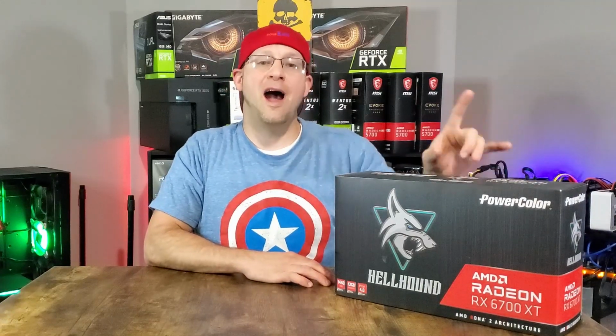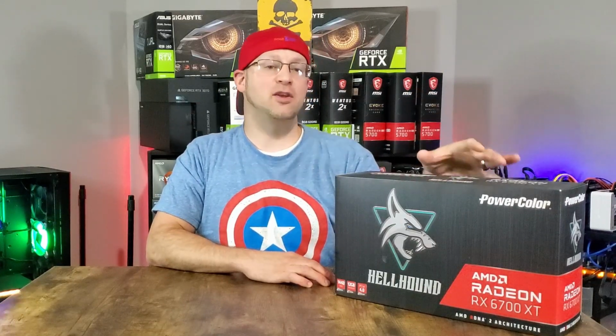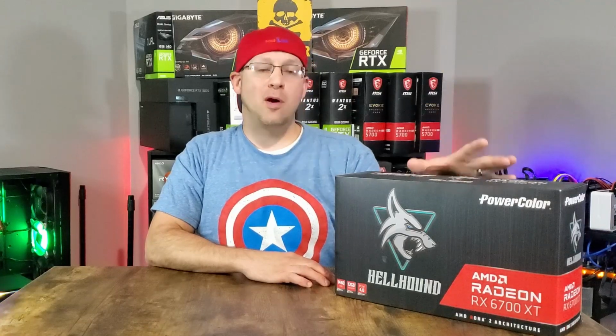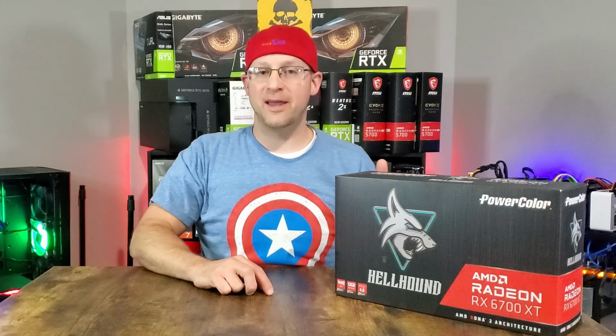And I know you're gonna wonder how much I paid for this. I actually paid MSRP on this, and it ran just over $900 US through Amazon. These are probably the easiest of the newest generation cards to get because of the lower hash per dollar that you're getting out of these. Comparatively, you could get a 3060 at MSRP at $400 that does 48 to 50 mega hash, when this one only does 47 mega hash at over $900. So that's why it's the easiest to get, the 6700 XT.